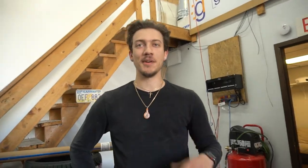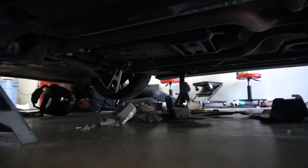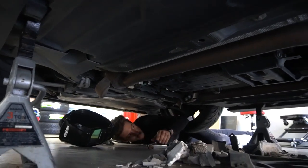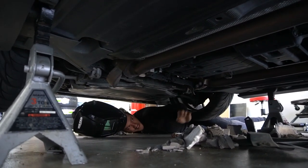Alright, wear your PPE. Isaiah's gonna go ahead and weld that shut — I got it all out. He's welding closed the slots we cut in my primary cats to get all the honeycomb material out. Once he welds that back shut, we're gonna do a little startup with no primary cats but still with the secondary cats on, just to hear the difference in sound.